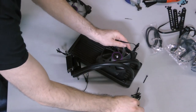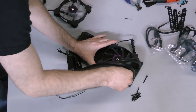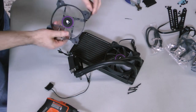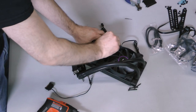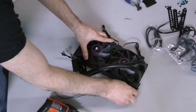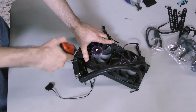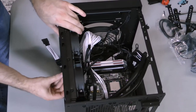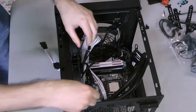Installing the Hydro Series H100i into the Obsidian Series 250D can require a little bit of finesse, but it definitely works. I've already installed the backplate for the cooler on the motherboard, so now I need to prep the cooler itself. I'm using AF120 LED fans instead of the stock fans or aftermarket static pressure fans, but the trade-off in performance shouldn't be too devastating since I'm not going to be pushing the i7-4770K that hard. Start by installing the fans as intakes for the radiator using the long screws included with the H100i. Next, slide the radiator into the 250D — there's exactly enough space between the mounting bars and the motherboard for the complete H100i to fit, though it will likely require a little bit of pressure and shimmying to get it into place.